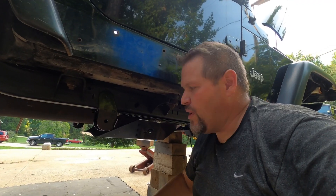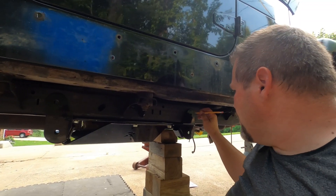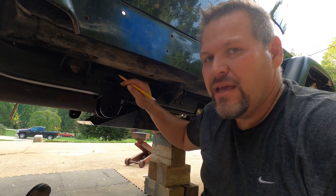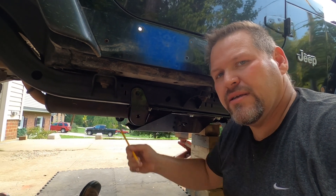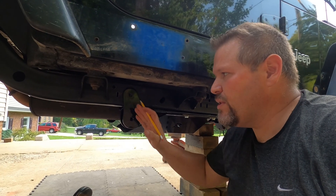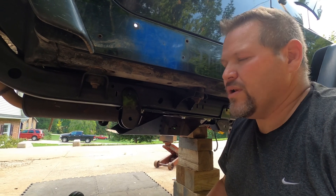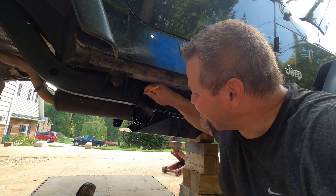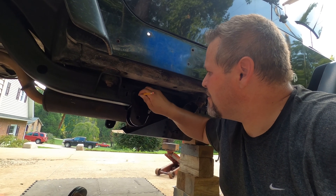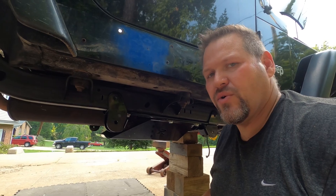The next thing to do after putting the belly pan on is to mark these holes. The front is pretty straightforward — get yourself a decent pencil or awl. The back, as we've experienced with both of our TJs, is that you're going to hit one of these slots only on the outside of the frame. The inside of the frame will be fine, but you're most likely going to need a carbide bit to open that hole up.